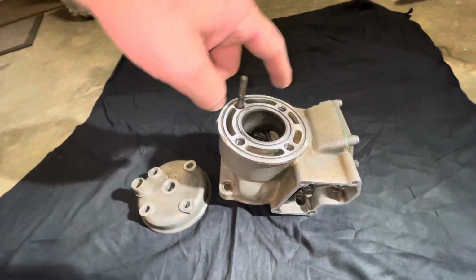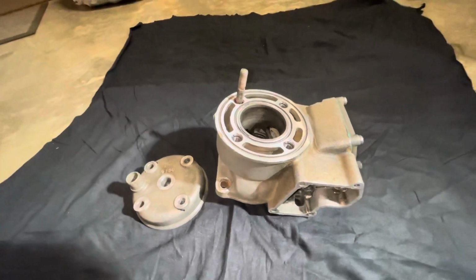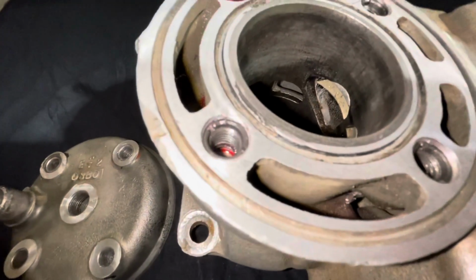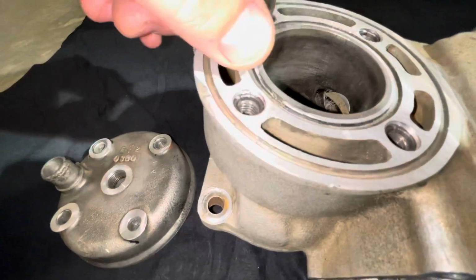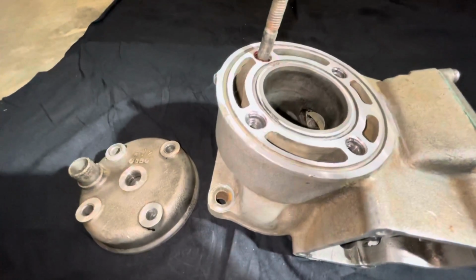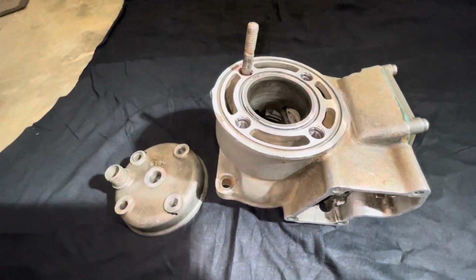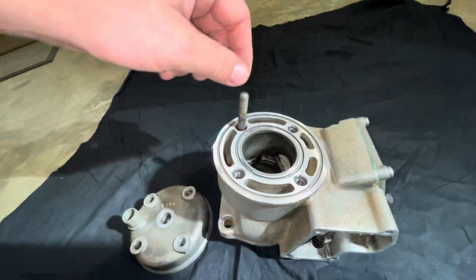It already had the helicoils in there, as some refer to, and I had to put something else in there. But since helicoils were already there, everything was already opened up, so I had to put in some thread inserts. So this is an M12 outside diameter insert and a regular 8mm insert on the inside. So the pitch is 1.75 for the M12 on the outside diameter and M8 by 1.25 for the inside, which is the head stud size.